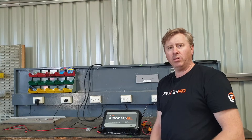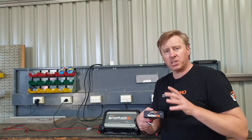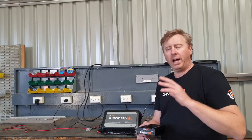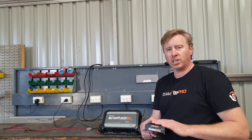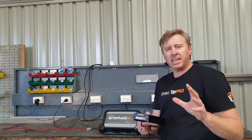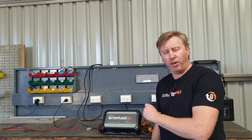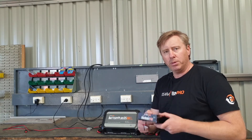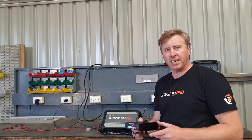What we do is we put in a DC-DC charger. The Mini Boost Pro is specifically designed to partner with the BP35 range or our J35 range, to provide a boost charge from the car's alternator back down to beside the battery. It's wired directly back through the auxiliary ports on our BP35, and as the voltage on the alternator drops off, this will boost it back up to a useful voltage for the battery to be able to charge itself.